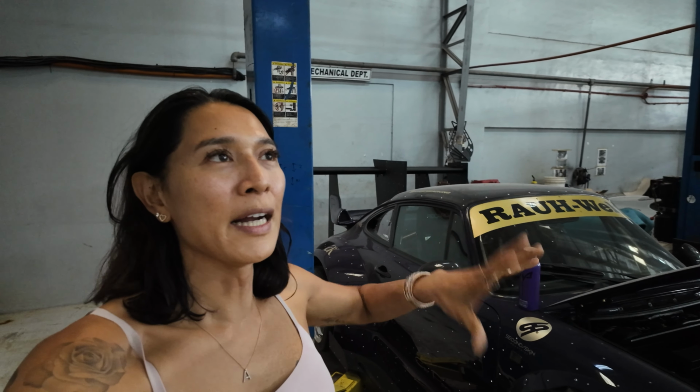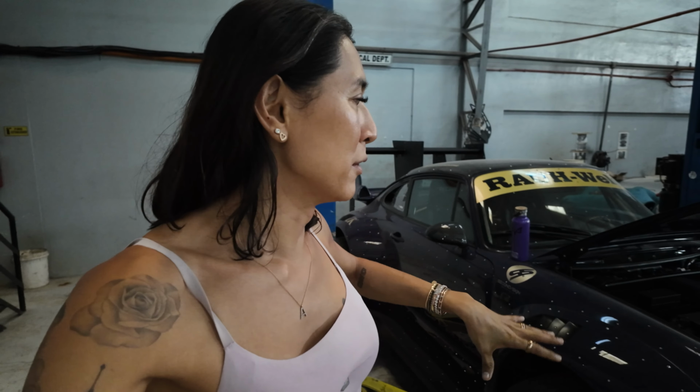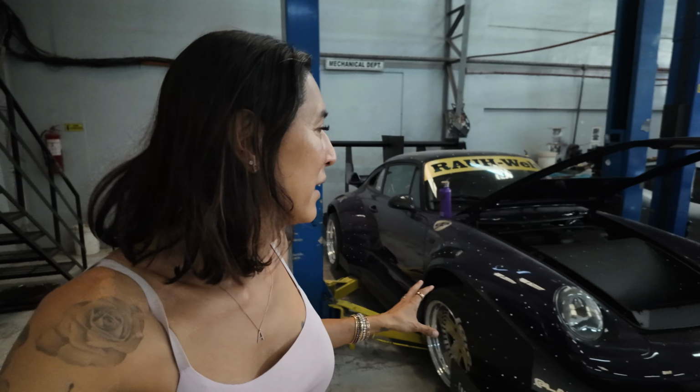But for this car, we want to remove the variable of the airbags heating up and changing ride height during testing. So the nice thing with standard springs, you basically remove that variable when you set the ride height. It's basically just the downforce that is affecting it, and not the heat of the air tank and the air lines and the airbags. So I want to give a huge shout out to Ohlins Philippines for hooking us up with some coilovers. It's my first time to use Ohlins, and I'm pretty excited to see how it'll handle with this car. Now, I'll also go over the AirShaper report that was given to me, and we made a few mistakes on the first upload, so we're actually going to run a simulation again on this car.